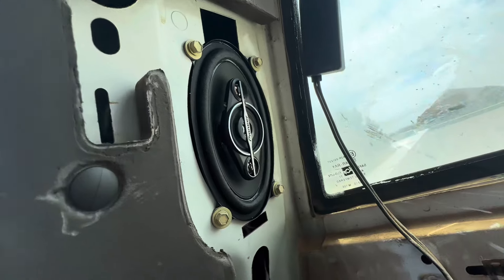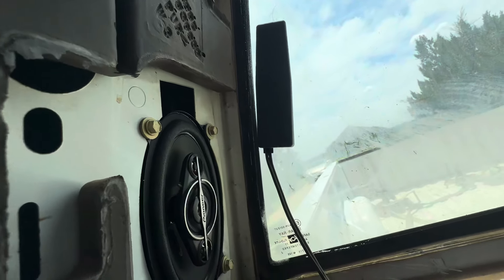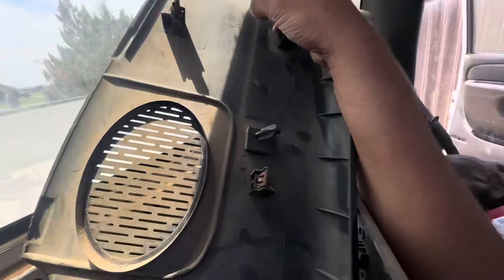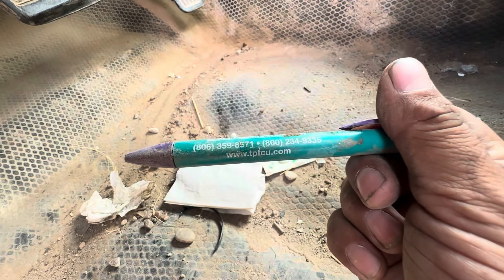This is what it takes to get to your rear speakers on these. You pull out two screws over here — actually you unsnap this first, then those screws, and then I just bend it back and hold it with a bungee cord. If you've got the poverty spec like this truck, you'll find out you don't have speakers at all. I drill the same way, run those screws in, hold the speaker down, and that's all there is to it. I'm going to do the other side and then we'll go see if it passes state inspection.